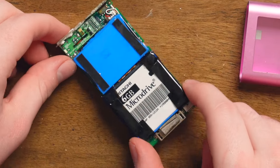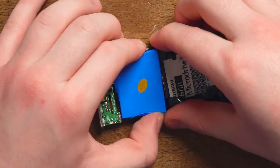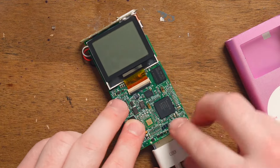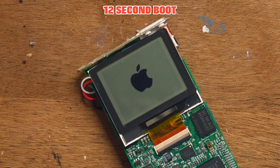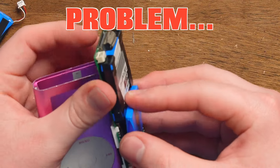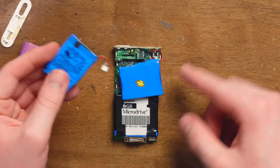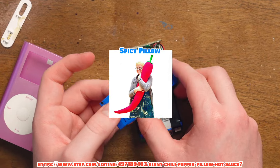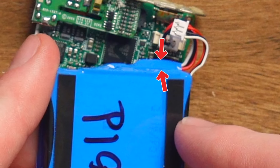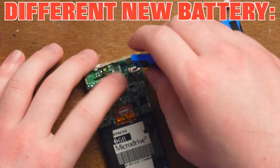There's your battery, and there's your Hitachi 6 gigabyte micro drive. That's the bad battery; that's the new battery. I'll try to clean the inside of the screen as well before I go putting the thing back together. It's turning on — I hear the little teeny hard drive spinning up, and it's on. It didn't die. I had to grab a different battery, even though this one works. See, it has this bulge here — this isn't like an expanded pillow battery, it just has the components coming out of it right there. On this one, which is the old battery, it doesn't have that, so it sticks out that much more, which is a lot in an iPod like this. I can kind of cram it in there, but not without damaging anything. I'm not going for a janky installation; I'm going for a actually-works installation.